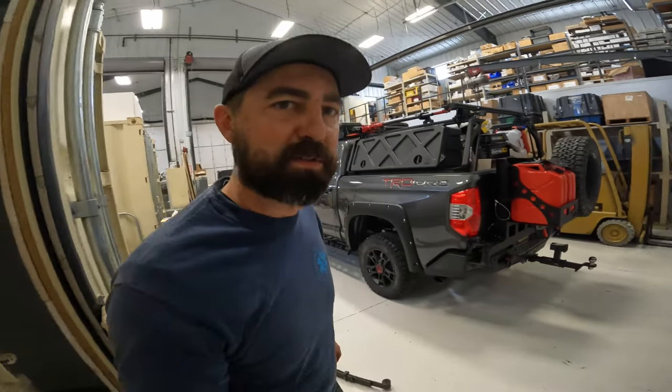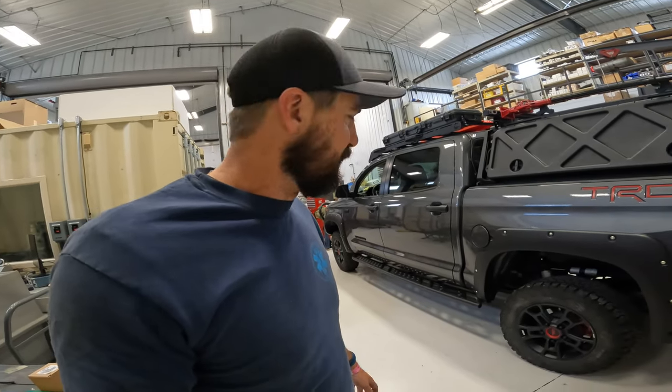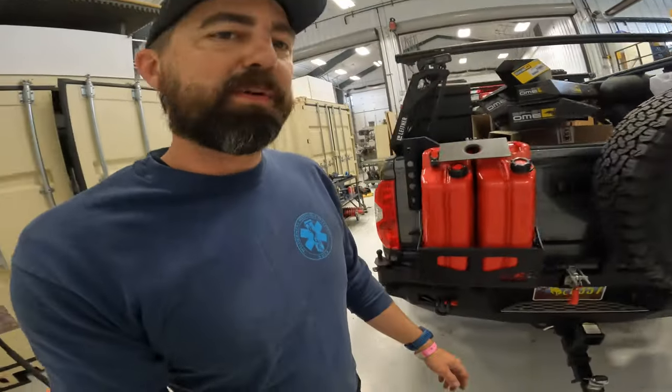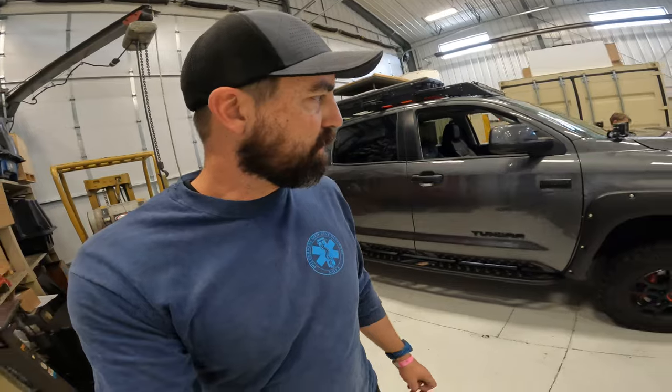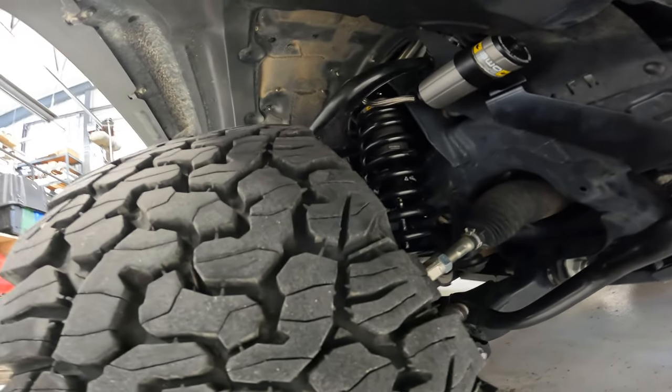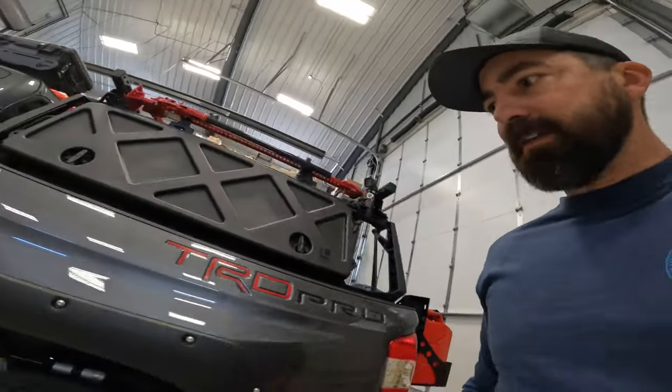That wasn't the worst but it wasn't the easiest either. I think with some patience and some mechanical aptitude you can definitely knock this out at home. I was fortunate to have access to my buddy Cliff Jennings of Jennings Racing Shop, and that proved to be very helpful. The back is no longer squatty — we're quite a bit taller all the way around. If you're running a heavy bumper and a winch, you need the spring compression tool to adjust the preload compression on the spring from 10 millimeters to 25 millimeters, which is basically an inch — and that is impossible to do without the right tool.